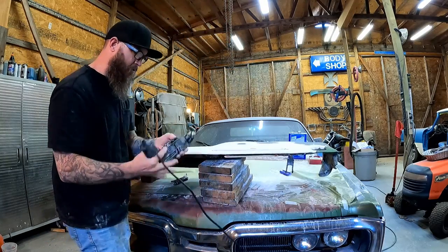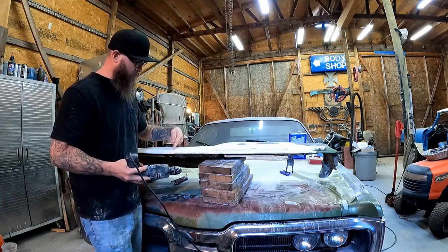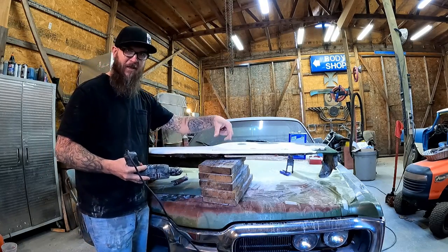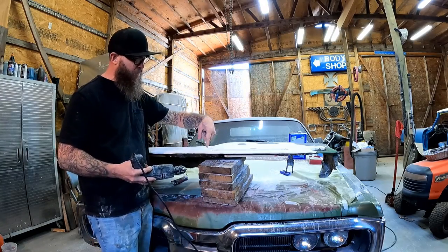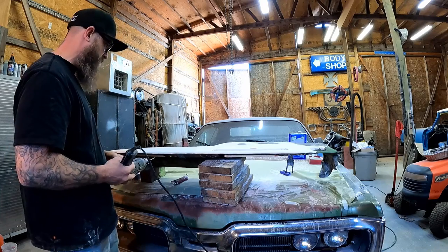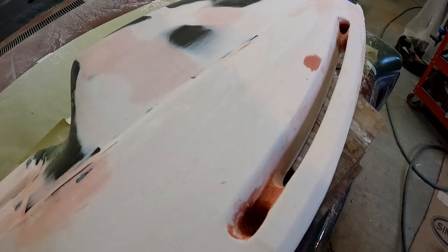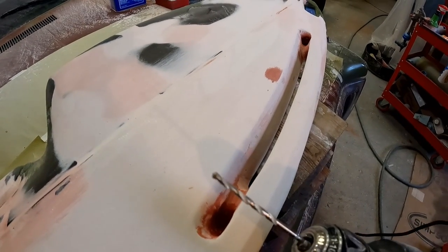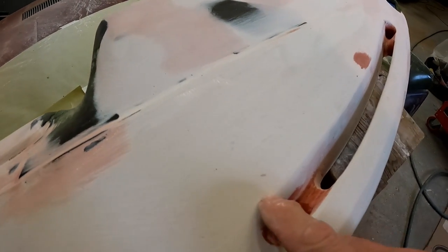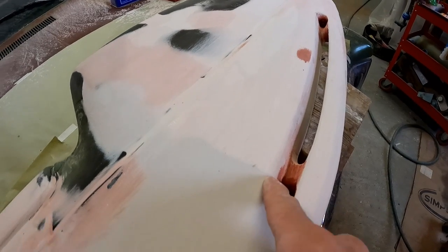The biggest thing is to make sure we don't do too much of an angle, because if we get too much of an angle the hole will be outside of the actual vent. It's got to be down in the vent — it can't be out here too far one way or the other. If I was drilling this hole and the angle was too far, we would end up popping out of the hole up here outside of where the actual vent will be. We got one more — it's going to be around over in this area here.